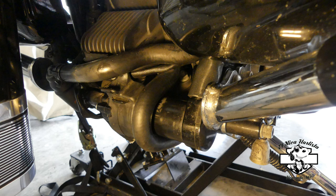On a later video I'm gonna show a fix that I did to isolate the water hose that wraps around the water pump with a heat shield, just to minimize heat, and let the pump get less heat from the actual water hose that is wrapping around the pump, which I think is a bad design. It's a lot of heat going through there, and I think that probably will shorten the life of the pump because of too much heat concentrated in that area.